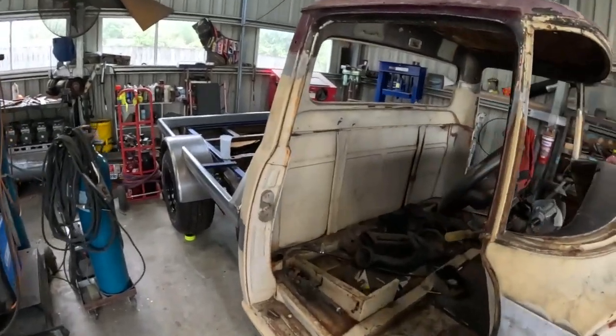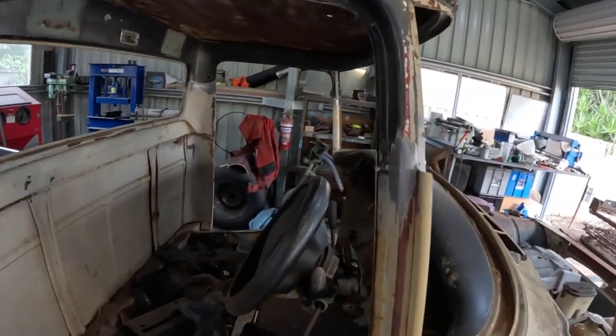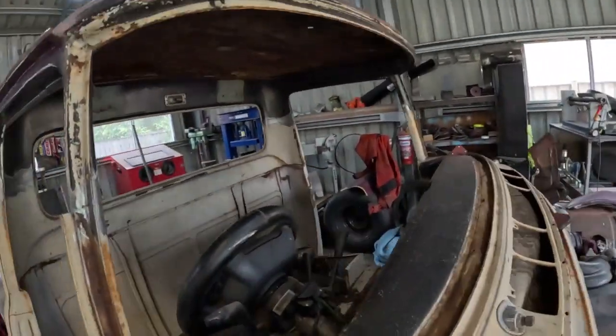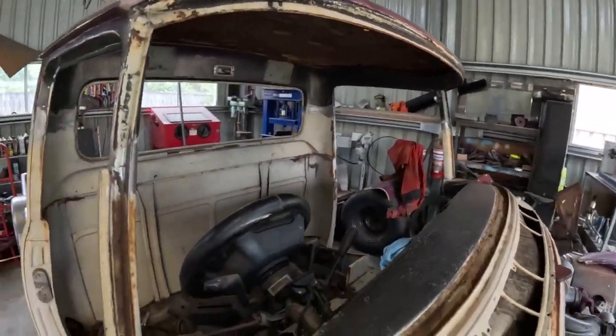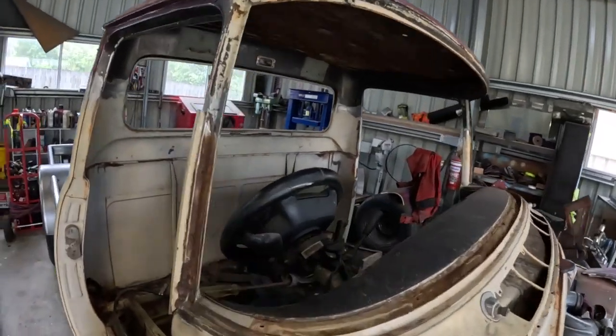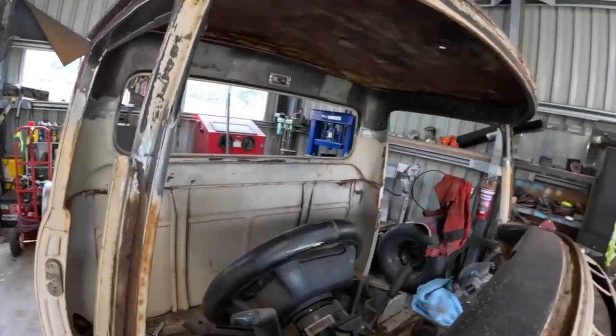And like I said, I've got some spare time. So what I'm going to go ahead and do is just a couple of spots on these pillars, mainly on the back side, where I'm going to TIG weld. I didn't bother MIG welding them because of the nice tight gap, and I've got some gas back in my TIG now. So going to go ahead, get them tacked up, and we'll button her up.